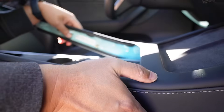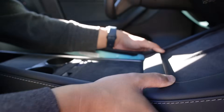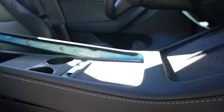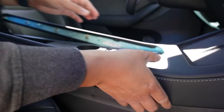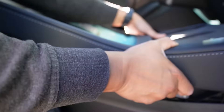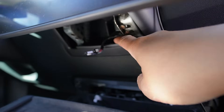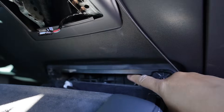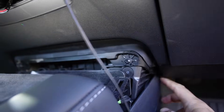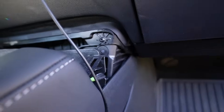After all the side panels are released, pull up the top part — there are a couple of clips, so just pull it upward. If it's hard to pull, use a trim tool to help release it — there are actually three clips. You don't have to remove the entire trim, just pull it down to get access between the panels so you can fish the wire all the way down and around to the bottom. That's how we're going to run the wire.